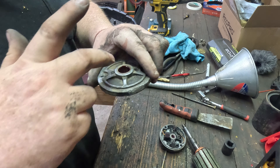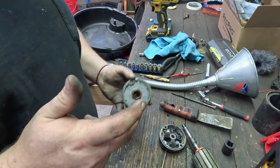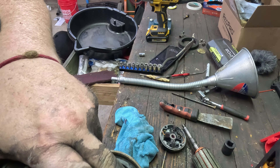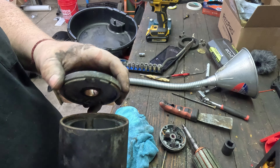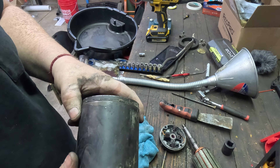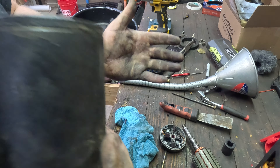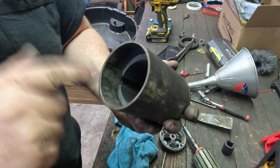This one's not so hard to grease — just whatever finger fits best in the hole. My memory might have failed on me — I was debating on which cap goes where. These starters have little divots, and it also corresponds with our marks. Fortunately this starter actually has a mark, but there's our marks. If I put this cap on the wrong side it won't index correctly with our mark — so that is how that cap goes.